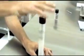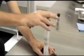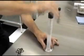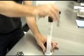Place your hand on the red handle and pump using full strokes. Don't push down too hard to avoid damage to the washer. Bottom bearing should travel around the 40 cc mark. Pump for about 20 seconds with quick strokes.